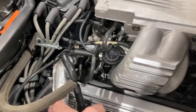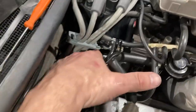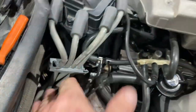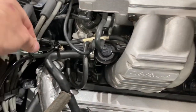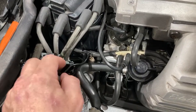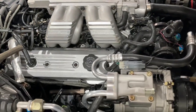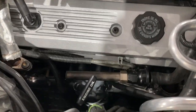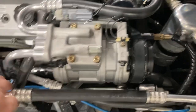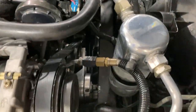The EGR here — in the earlier videos I showed you where it's blocked off and has a plate here. It's just really dummied up and it keeps this sensor in place, which does throw a code if it's not working. What else we got done here: all the exhaust manifolds hooked up, the air injection hooked up, the compressor, the brackets, all of the different fuel stuff for this car, which is that FMU stuff.